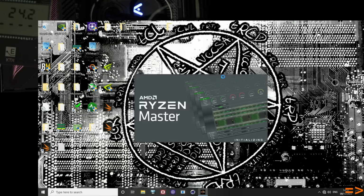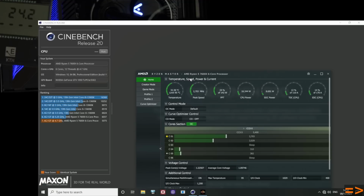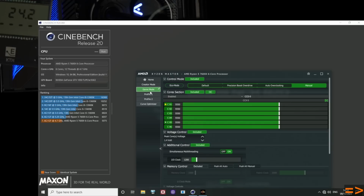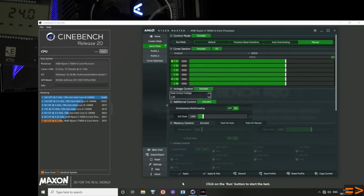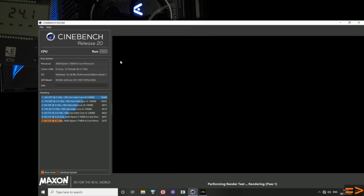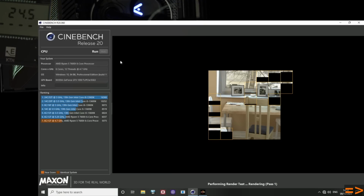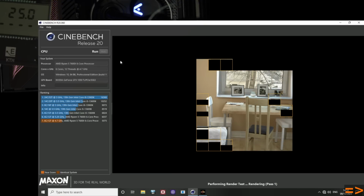I think it's still worth showing what happens if we just keep lowering the voltage at 5.55, because right now it might look like, oh, if you just keep lowering the voltage, frequency just keeps getting better. And no, that doesn't work that way. So we're going to go all the way down to 1.25 volts with 5.555, right? Which is a very low voltage. And if we try to run that, it's supposed to crash. This isn't fair. Okay, there, it died.